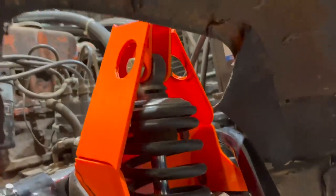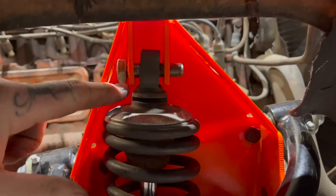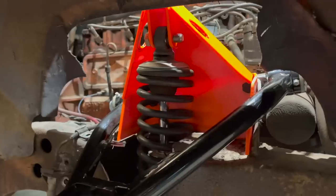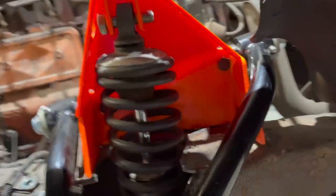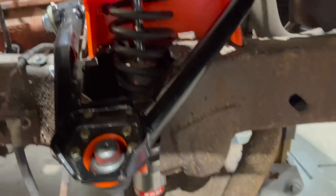And there she is. This is going to be moved up a quarter of an inch, which will put it dead center of that piece right there. But look at that — that looks really good, man. It's literally sitting right on this factory wheel well — it couldn't have gotten any closer. I used the rear coilover springs off of Uncle Sam just to make sure it was going to clear in the back. I still have a whole lot more I can take out of this thing, but I wanted to make sure it wasn't going to hit the back of the bracket or anything like that. It's still pretty much lined up exactly where it's going to go.